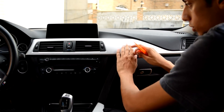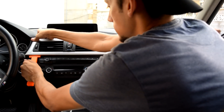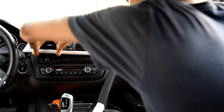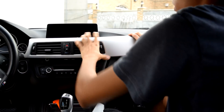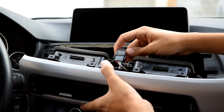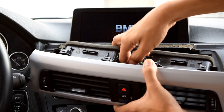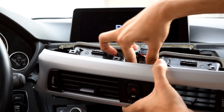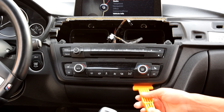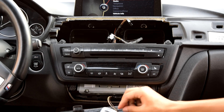To start the install, go ahead and remove this trim panel using your trim remover. Once you've gotten some of it out, just go ahead and pull it off by hand — pull out straight. Once you've gotten the trim piece removed, flip it over and unhook this cable. Just be careful. Then there's a plug right under here that you need to remove — it's hard to get, just go ahead and pull. It should come right out. Once you've gotten that out, put this to the side. Next step is to remove this little panel right here using your trim tool — just pull it down and it'll slip right out. Go ahead and unhook this plug right here.